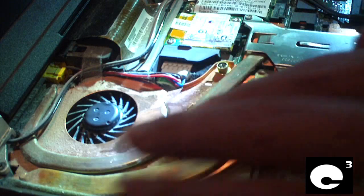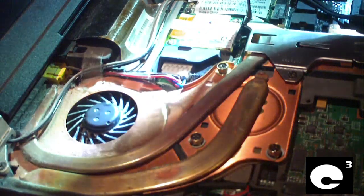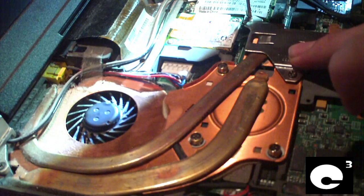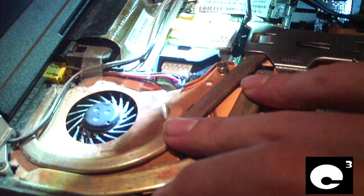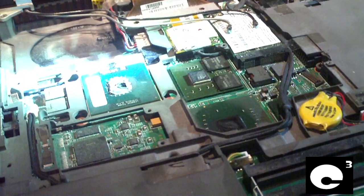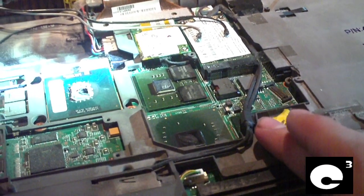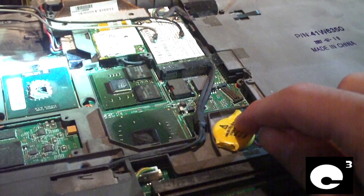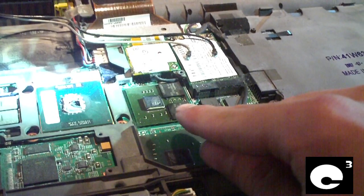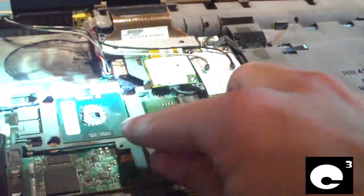So what I'm going to do here is remove the entire cooling system itself. After reading online and watching a YouTube video, you have to take off this little bracket and then these four screws, and that should release the cooler. I just pulled off the cooler. This machine has a separate discrete graphics processor rather than integrated graphics into the Northbridge. Here's the Intel Southbridge chip under this battery. Here is the Intel Northbridge, here's the ATI GPU — you can see the two Hynix memory chips on the chip itself — and here is the processor.